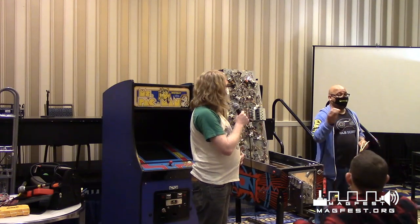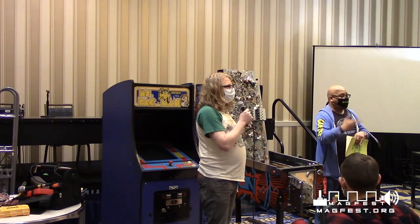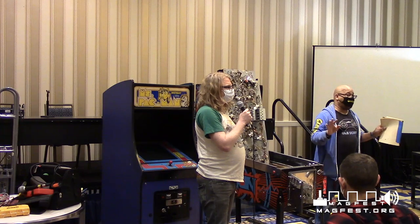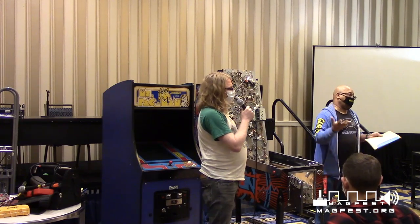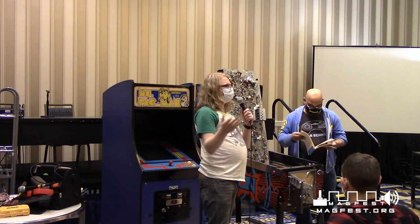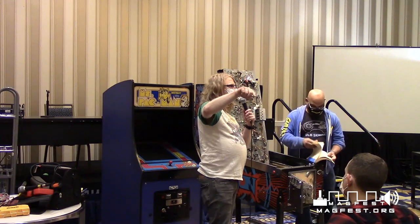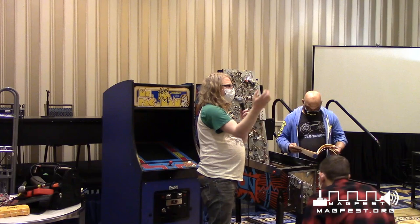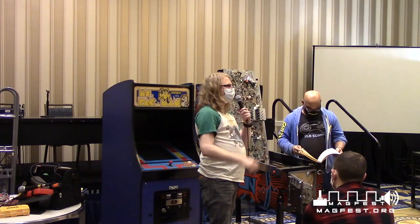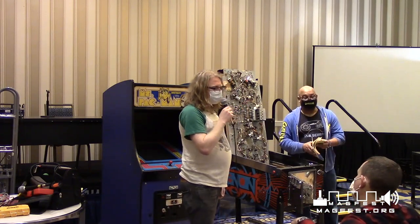Usually those drivers actually pull the ball. It has sensors in it so it knows there's a ball there and it'll activate. That's why sometimes you see a pinball machine where it throws the ball around. I don't know how those work. I've only worked with one and never pulled it out. It basically acts as a standard magnet. Take a game like Getaway 2 High Speed or No Fear, down in the arcade. It takes the ball and propels it forward using a series of magnets that pulse: magnet, magnet, magnet. The first grabs the ball and shoots it forward, the next magnet grabs the ball and shoots it forward, and the next does the same. So it's actually getting pulled? Yep. The illusion of being pushed away. Yep, exactly.